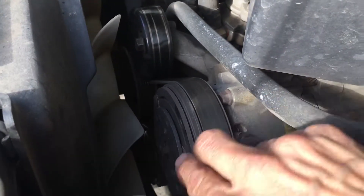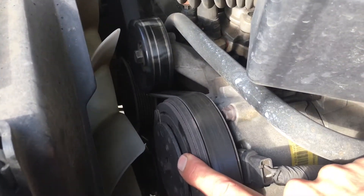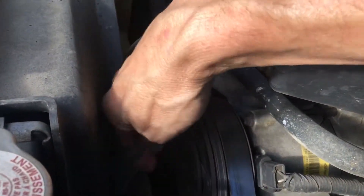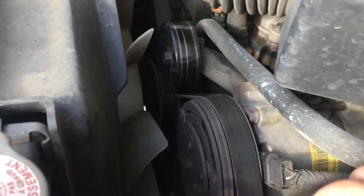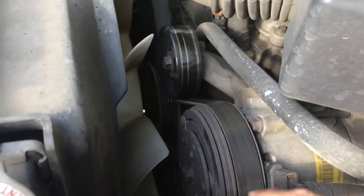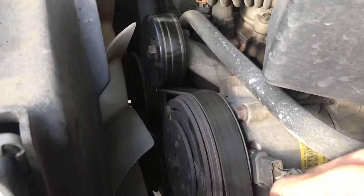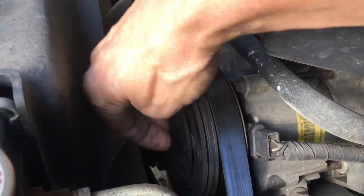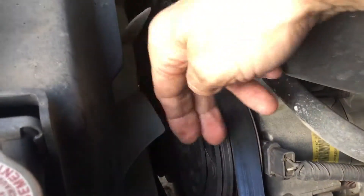The iron is now hot and it's no longer strong enough to pull in across that gap. That's what you see — those YouTuber guys hitting on the center, hitting the compressor. Yeah, they disturb it, but they don't always hit on the right place. You see them playing around because they've seen somebody else do it. It's the gap you want to hit — not necessarily the center. But you didn't hear that from me.